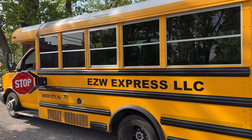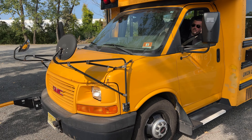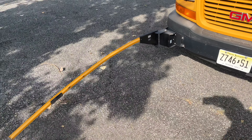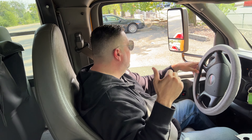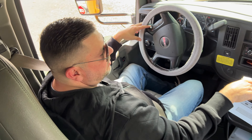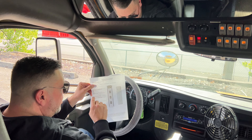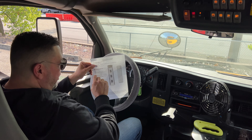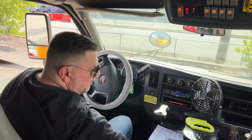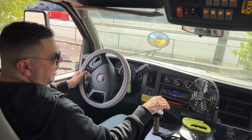You could have left the door open with the master switch on - probably the passenger door open along with the stop arm and front safe arm - and he just would have walked to the rear and made sure the lights were working in the back for the hazard lights. Now that we've checked all the lights - the emergency lights front and back for the pickup of the children, the hazard lights, signal lights, and high beams - you're set to go. You've marked several boxes: the external light check, the student lights for the school bus front and back, and the stop arm and safety arm for the external part.